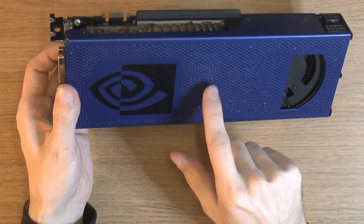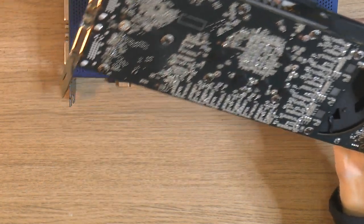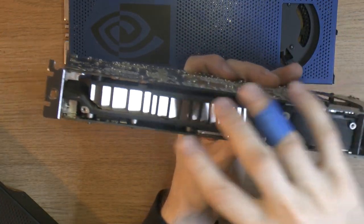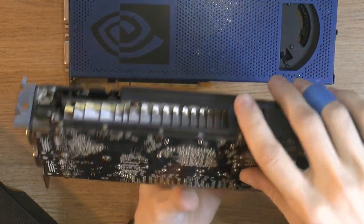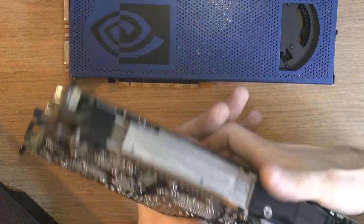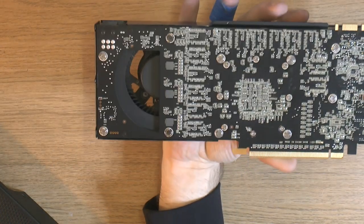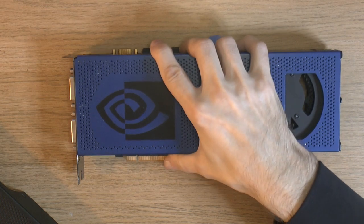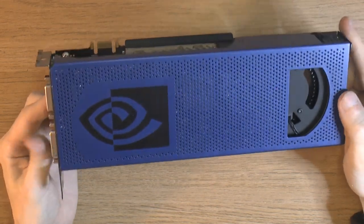And this side doesn't have that problem, because if we look at the other card, you can see some rubbery standoffs around here. So when you mount this cover on, it screws into here, I think over here and here, and you basically have to push it down to screw it in, which means this PCB is squished against the heatsink, and this one wants to fall away by gravity. So that's why I shim modded this card, and a 6-7 degree difference is a lot, especially when the card wants to kill itself with heat. So yeah, I think this is gonna be the start of my show, so to speak, this build.